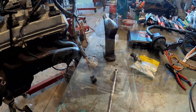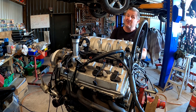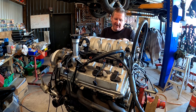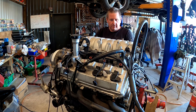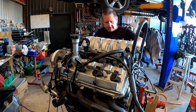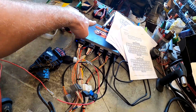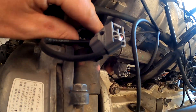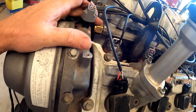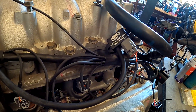Let's compare it to this harness as I put it on. With this loom, of course it's all new, and the rear harness is suitable for the 4Runner — and I'll interchange between 4Runner and Surf; to me they are the same vehicle, though of course there are differences even within Surf models. Regarding the oil pressure: with this one I've added the Bosch combination oil pressure and oil temperature sensor that goes back to the Thunder ECU, and the Thunder outputs a signal for the oil pressure gauge on the dash. I've also mounted a fuel pressure sensor, which allows us to monitor the fuel pump and how the engine is running to improve the tune. The Thunder's got twin wide-bands, an external MAP sensor — just put a 1.15 bar MAP on.